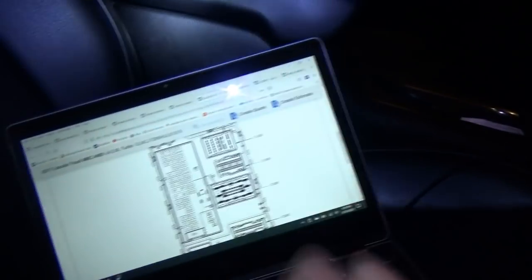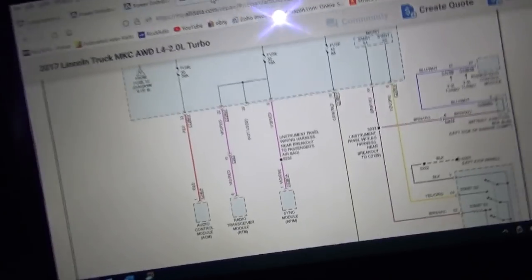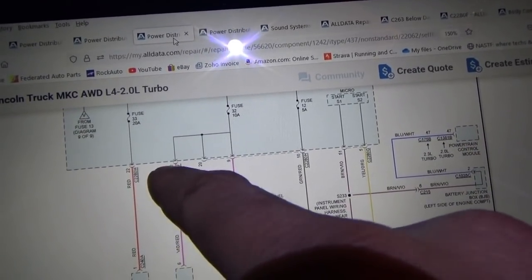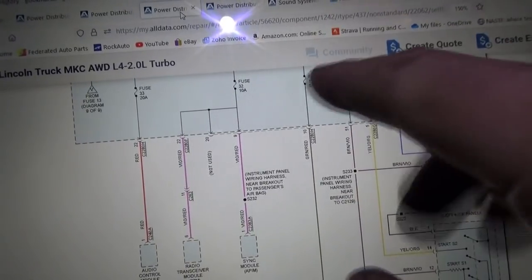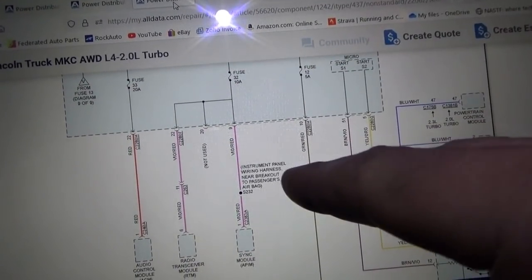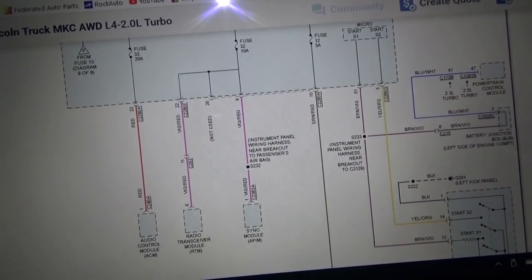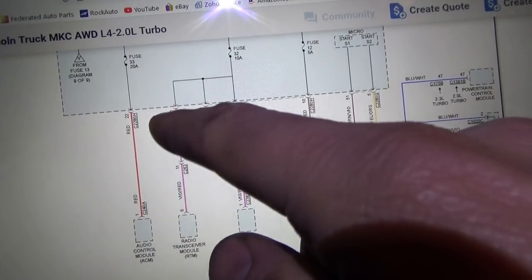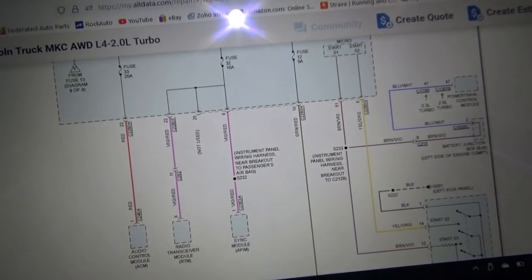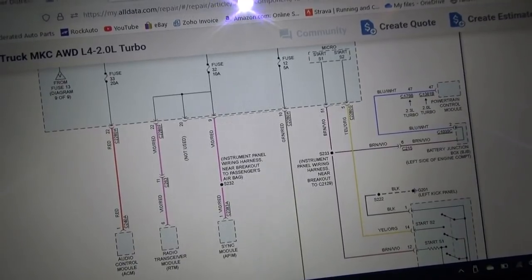So now, let's go to the BCM. The only way to separate these two modules without ripping apart the entire interior is at the BCM. We can de-pin pin 22 that goes to the radio transceiver module, plug everything in, plug the fuse in, see if the thing goes to sleep, and if our problem goes away, we're calling this RTM. If the problem's still there, then it's going to be the sync module. So we need to get to this pin right here on connector 2280F, or we can unplug the sync module at pin 9 on 2280G.